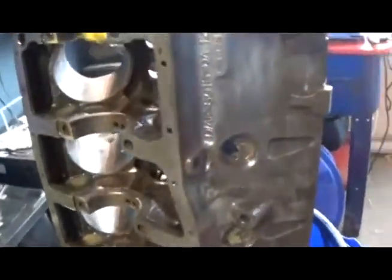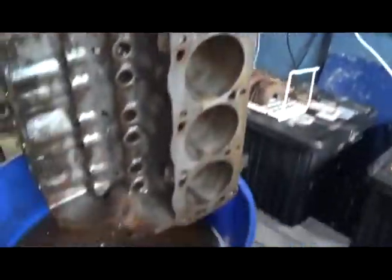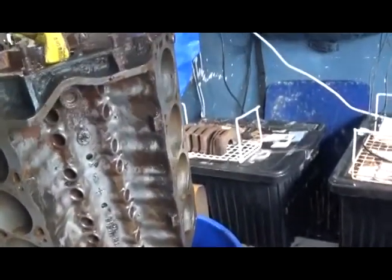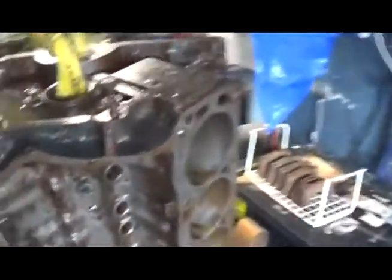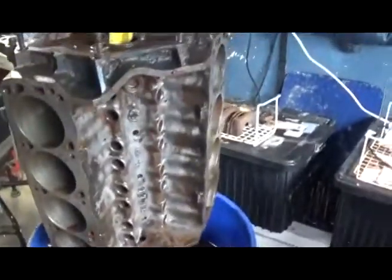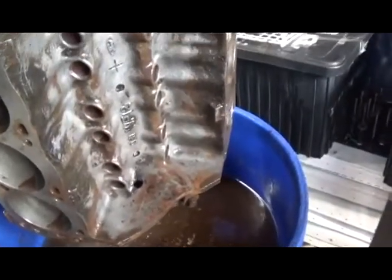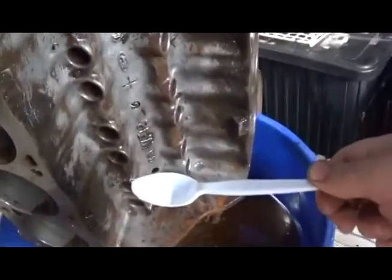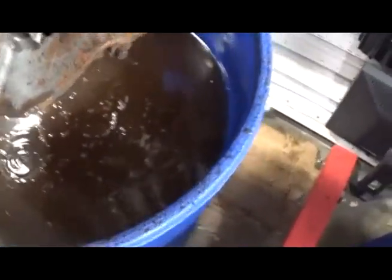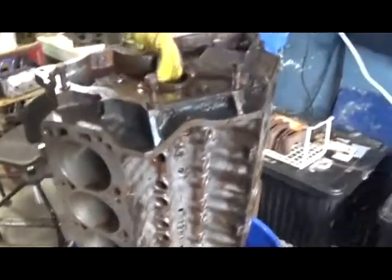We're finally getting a good look at this, and it is absolutely awesome. We'll be able to give it another once over with that brass over copper brush, and it almost looked like it was sandblasted. We may soak it — we're not going to have to do another day of electrolysis. No way. Anyways, this acid's lost its oomph. The way you test that — it's like your old grade school volcano experiment. Some baking soda, no reaction. The vinegar has lost its oomph, so its acidity is gone.